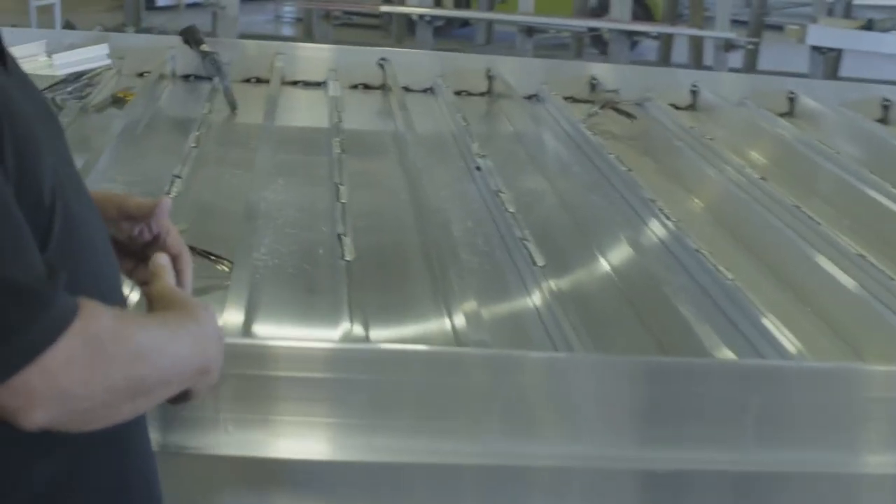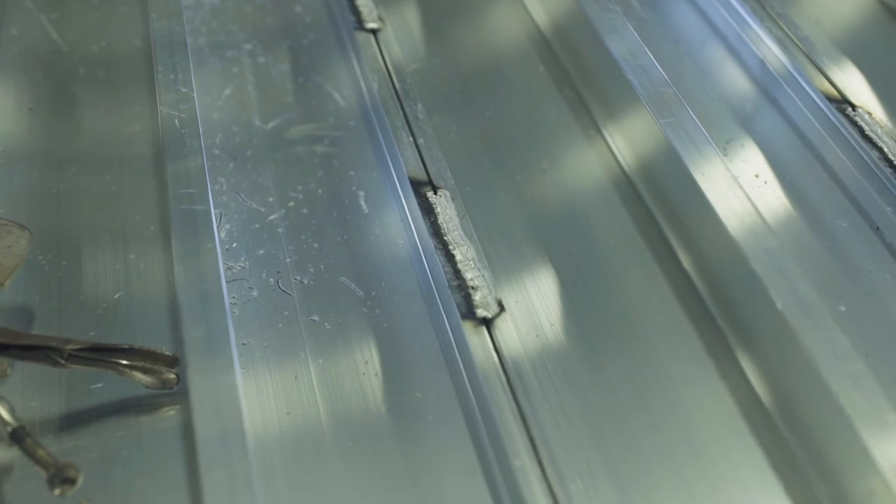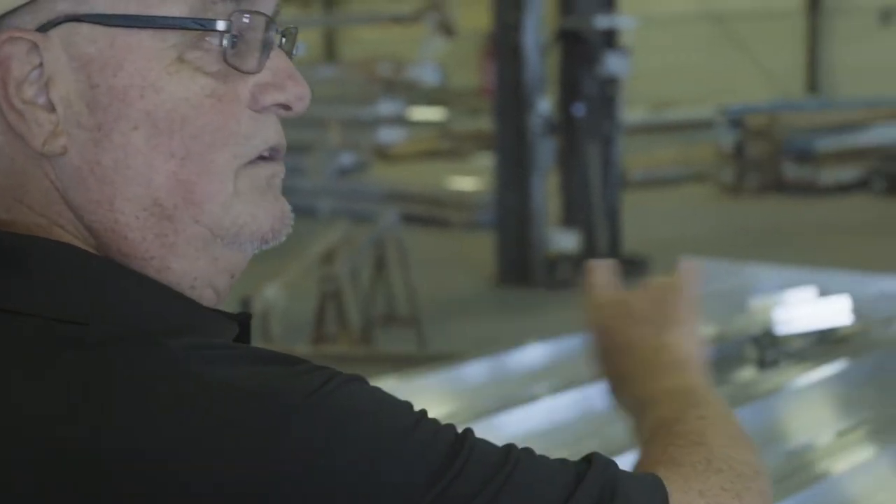This is being built upside down, so what you're seeing is underneath the trailer. This floor is constructed of a nine-inch mainframe, with 12-inch deck boards that go together kind of like Lincoln Logs. It's a tongue and groove construction. When they are all fitted together and welded, you'll notice on the far side the weld is continuous on both sides.